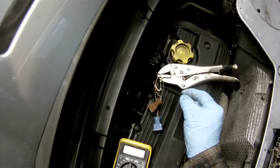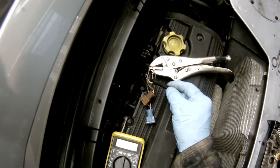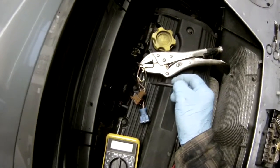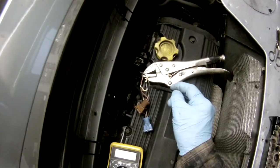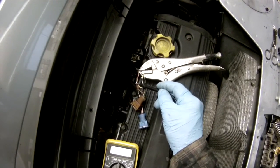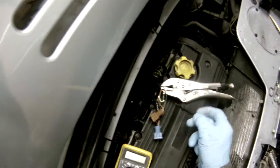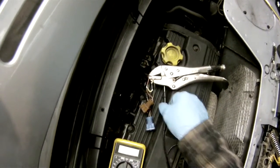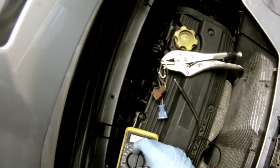What you can do is put a diode like this — I happen to have a 1N4003, which is about a 1 amp diode, which should be good enough to protect it. The band on one side of the diode means that side conducts when negative, so you connect the banded side to the positive side of the coil. On both of them the blackish wire side is negative and the brownish one is positive, so the band on the diode connects to the positive. Pull back the sleeve, clamp the diode in, insulate it all up, put the sleeve back over — looks the same as normal but protects the coil and saves you having to buy new coils.